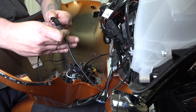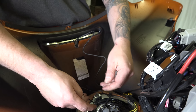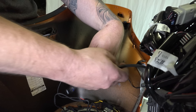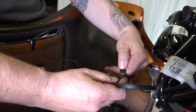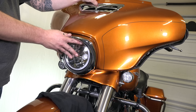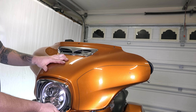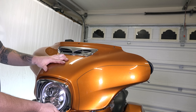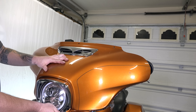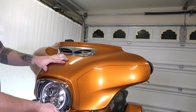For wire management, he's got the strip lighting there and he's pulling it through over the fairing — just taping it up so when we put the fairing back on we don't have to manage it. You can see how he bent it right over the fairing and taped it up. He'll do the same for the other side, wrapping it up and over the strip lighting and taping it on the inside. We've split the signal on our left side. We've got the actual strip lights — he'll plug that in. Make sure it clicks. Then he's moving to the other side, finding his strip light and split signal wire, pulling it through the fairing, and plugging that one in.